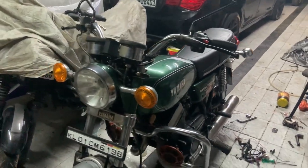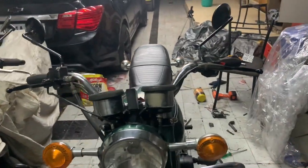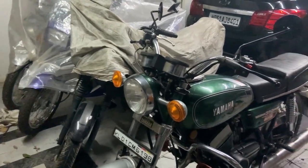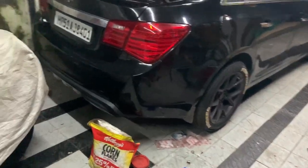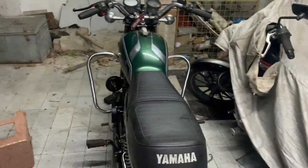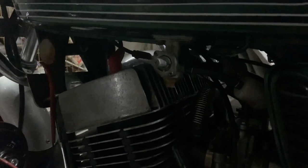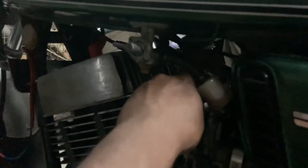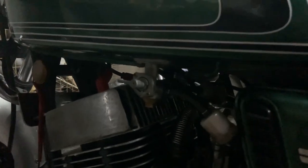That was the bike actually running out of petrol, because that is the reason why you saw the idle climbing slightly towards the end, and also one cylinder was intermittently firing because the length of these fuel tubes are not equal. One is longer than the other. So that is the reason why you'll see there is a bit of fuel here, but the other one is absolutely dry.